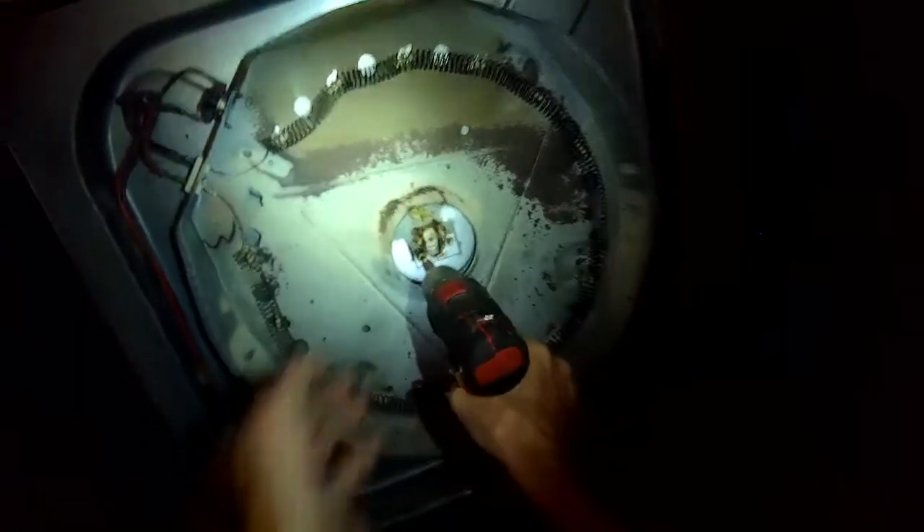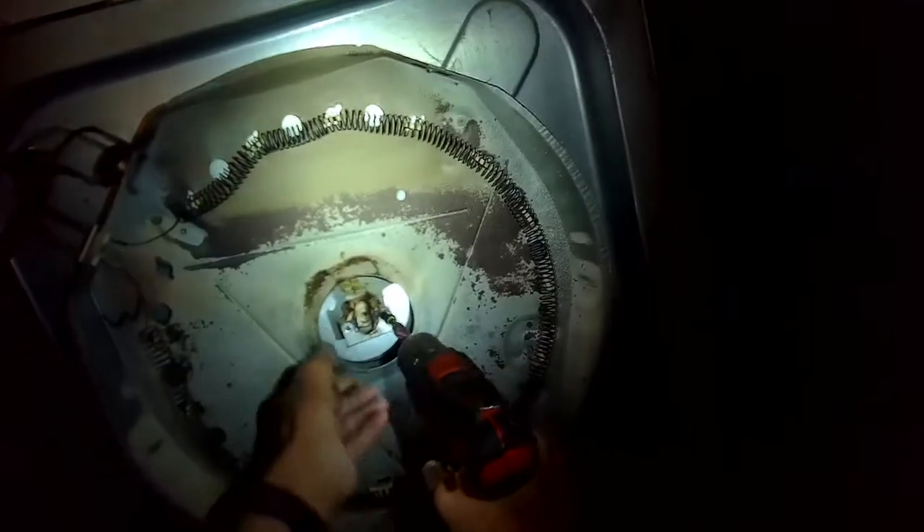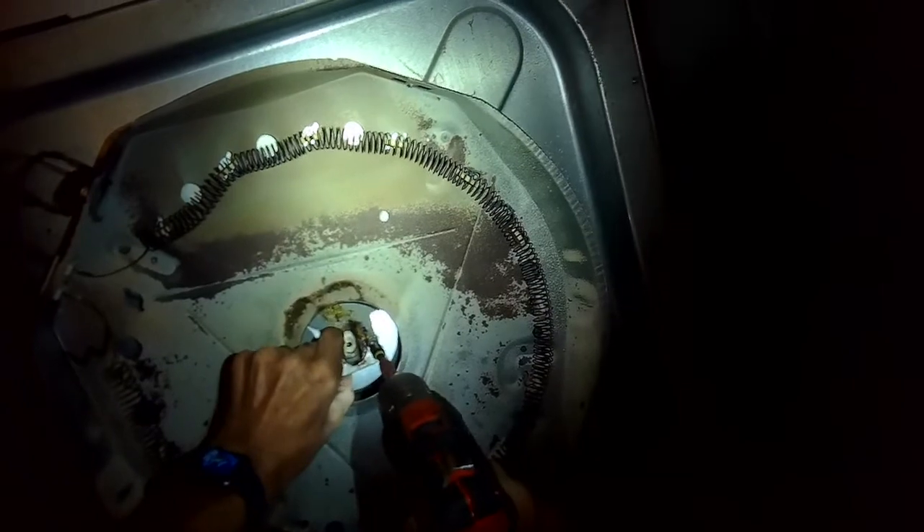So we want to make sure everything gets cleaned up. We're going to take a piece of tape and reach in from the top and put it behind, directly behind where that plastic cup is. That's going to help to hold on a little metal piece. I actually climbed into the dryer to do that to get up high enough. So now I'm taking out the old cup, and that piece of tape is holding on a piece of metal that these screws go into. It's very important that you put that tape on before you remove this piece to hold that little piece of metal.